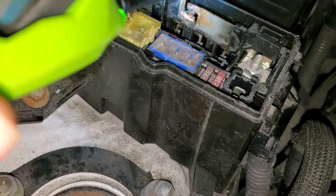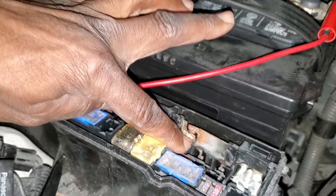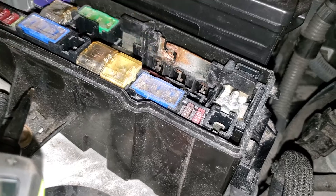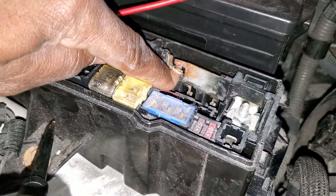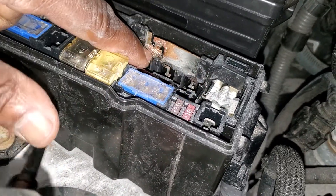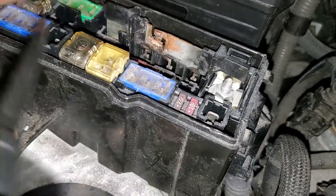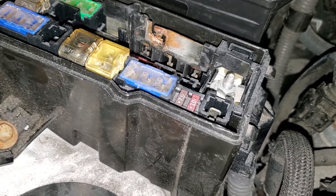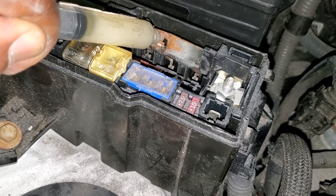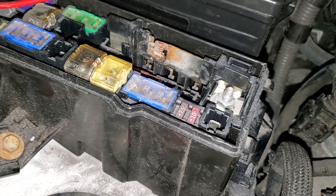To see if it's going to be okay, what we're going to do is disconnect the battery and try to solder this place — make a bridge between the two sides, even temporarily. In the future this won't resist the amps or the voltage flowing through, but I want to at least test it. First I'm going to apply flux here to clean the surface and help get a good solder joint.